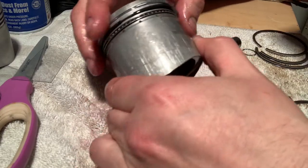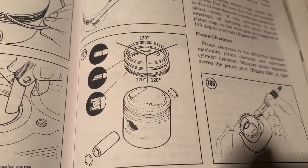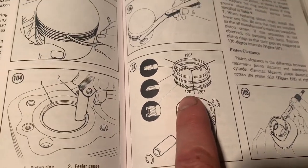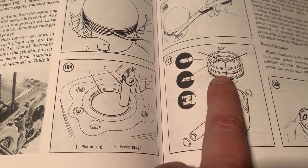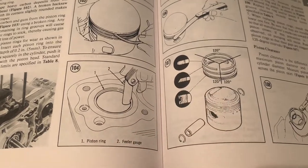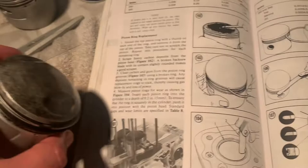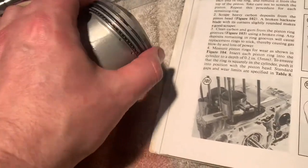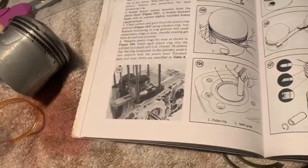They're all beautiful. Look at what we did and it's not even 10 o'clock yet. Here's the diagram I remember seeing - it's 120-degree separation on the different breaks in those different rings. You just don't want those all lined up. You want them all spread apart 120 degrees. So I'm going to go around the piston, make sure I've got those clearances, and I should be good to go. This is the original piston that was in the motor and I got a complete rebuild kit with piston rings for this, so I'm very confident in the right parts for this engine.